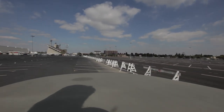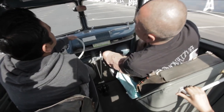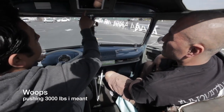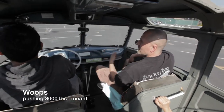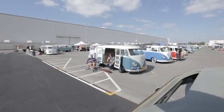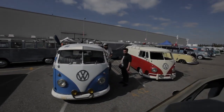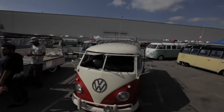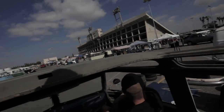All in all, I'd say this was a very successful test. It proves that in this particular application I shouldn't need much thermal control on these modules. It seems pushing 300 pounds around using an AC-50 motor simply does not draw enough energy out of 150 parallel cells to cause overheating problems — not even on cells that are near the end of their life. So I guess I should start building another 29 modules.